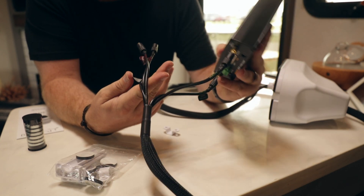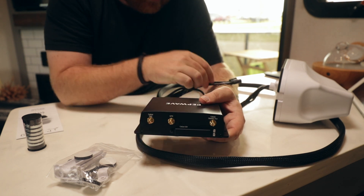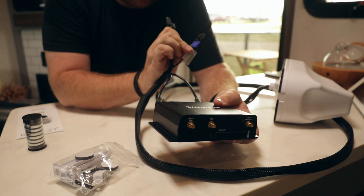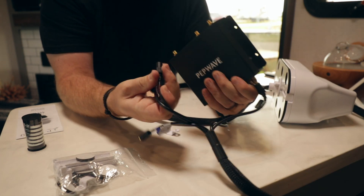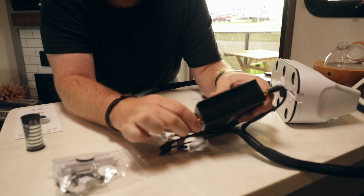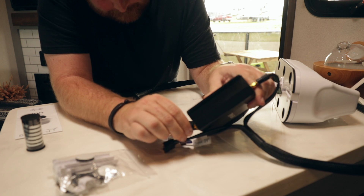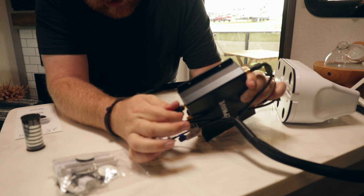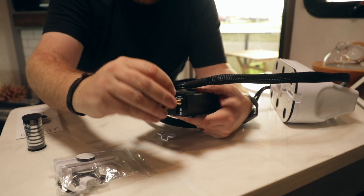On the other side is where these other three cables are going to go. We have two cell phone inputs and a GPS input. The cell phone ones are going to be these maroon cables, and then the GPS — which is labeled GPS — goes in the middle. This does take a bit of stretch to get done, so you're really going to have to work the cables. Make sure you go over the top of the unit, because if you're mounting the unit anywhere, it needs to be flush against that — you don't want the cables back there. It is a tight fit, but you can get them; just work with it and be patient. Be gentle though — it does not require any forcing, and you don't want these cables to break.